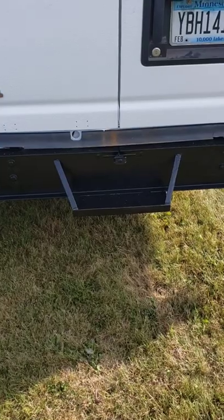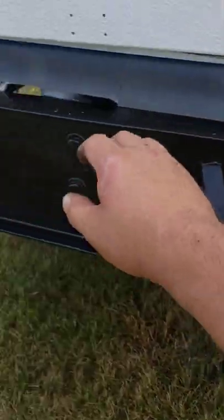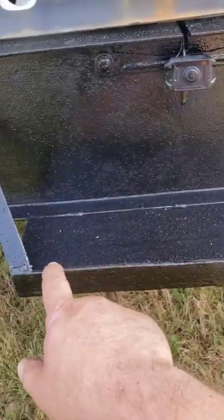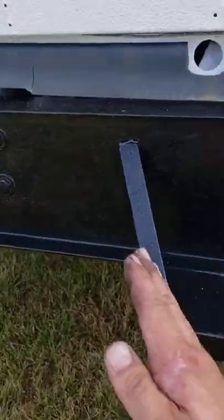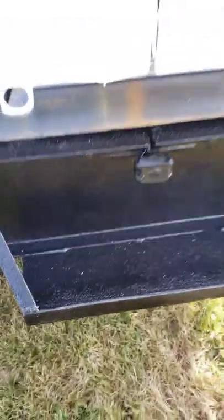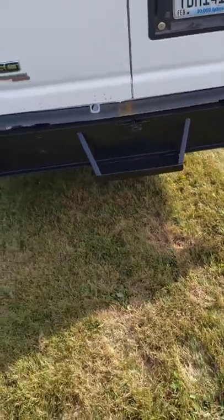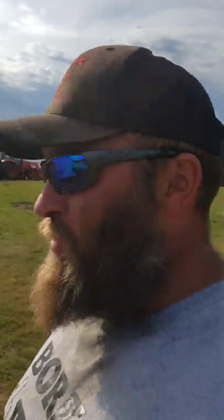As far as that step goes, you can make them a variety of different ways. I left this little lip here so the sole on your shoe can catch on that, and then you can also smack it with your ice scraper and scrape the ice off either side. That's why we didn't use a piece of angle or fill this pocket in — you want to be able to get that ice and stuff out of there in the wintertime. Because in Minnesota, it'll build up in there. Same reason I don't weld tread plate on there. Once you weld tread plate on there and that fills with ice, you'll get it out in April or the next time I have it in my shop and claw it out for you, because it's not coming off on its own at all.